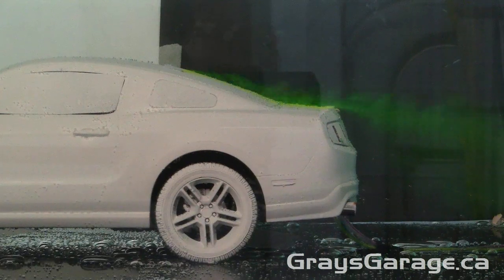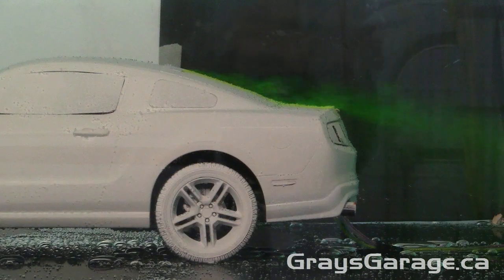If we zoom in on the back of the vehicle, we can see more clearly the flow along the rear windshield. The separation point is very well defined by the styling of the vehicle — it has a hard edge at the very rear just above the taillights, and this is where the flow leaves the surface. It can't make that sharp turn, so it continues on downstream. This is a very well-defined separation point that looks good for styling and is also very good for aerodynamics, helping with stability especially at high speed.